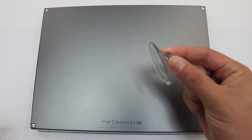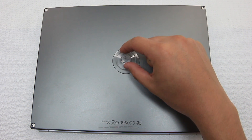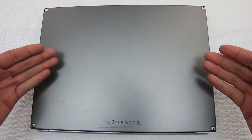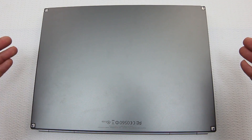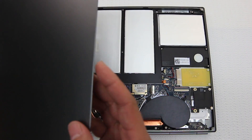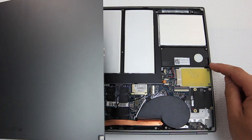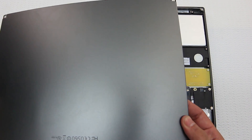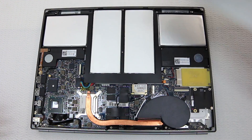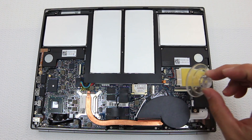The best method I went with was using a suction cup like this. Once I pulled, it would flex the aluminum inward, and when it would flex, it would undo the little latch on this hook right here. So it would flex a little bit, and then it was able to pop out and come out easily with this little suction cup.